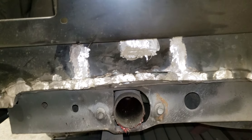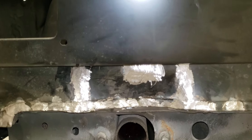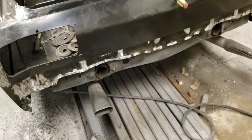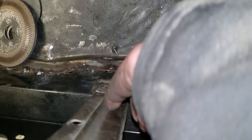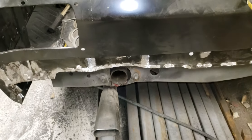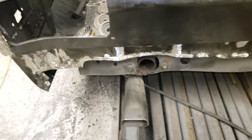I've spent all these hours grinding away here. You see that big shiny spot in the middle and the two lines going up and down? Well, this panel I got from AutoMetalDirect.com — it said some modifications may be necessary, and I talked about this in one of the other videos I posted. You see where this little brace is — that little part that bumps out? That is for the gas shock that goes in that hole right there. It needs room up there when the bumper's in so you can get to the bolts on the backside. Well, that panel — they didn't stamp it for that. They just left it flat.